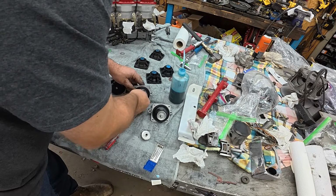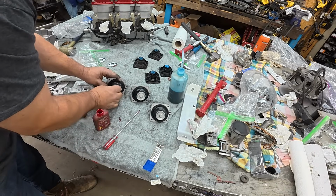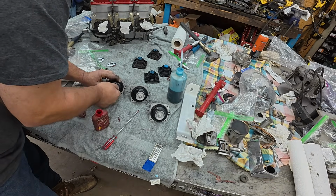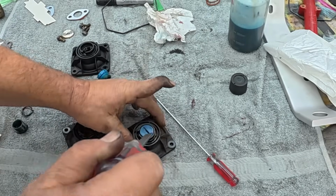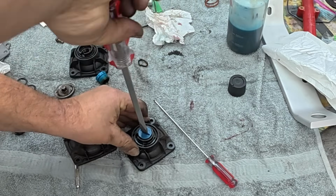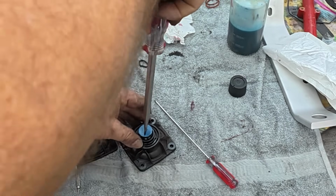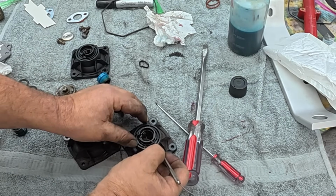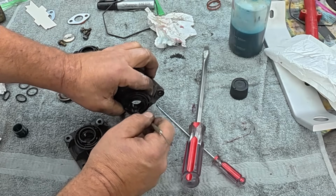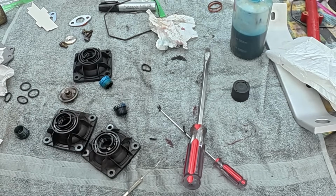All right. Make sure that this shoulder is in the hole in the bellows, that it's not pinching on the bellows. One last piece of business before we start installing these. There's an O-ring under each of these, and yep, one was torn. But of course, when you buy a full engine kit, you get some fresh O-rings. Oop, second one that was torn here, it looks like. Yep. Ooh, chunky pieces. All right, we'll go do some brake cleaner, clean these out, and O-rings and caps and the whole works.